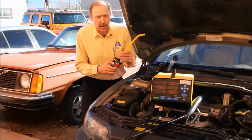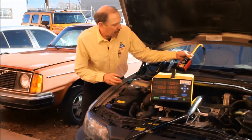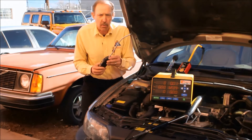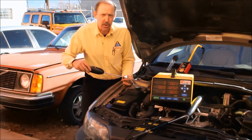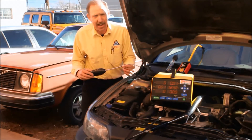Now I want to try some other systems to find CO2. We have another probe that finds CO2 for air conditioning systems — but are all probes equal? Let's see. As we can see, this indicator is not finding CO2. The sensitivity of this unit is not sensitive enough to find the small CO2 traces that you need to detect in order to know that the head has to come off again.